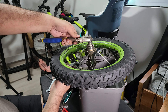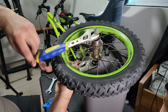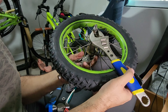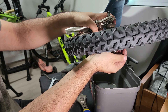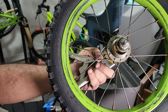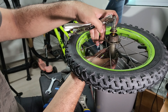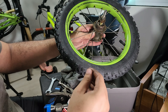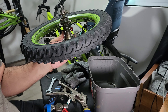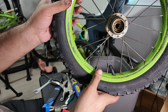Now I'll try to open the axle for the hub. For the center axle, you need to hold one end with a plier or wrench and rotate the other end to take it out. You need to be careful — the ball bearings are completely dried out, so have a tub underneath so you can collect them. Inside there's a lot of gunk, old rusted grease, and water ingress, so it needs a good service and clean up. Removing all the ball bearings — both sides had a lot of rust. Loosen the whole screw and the axle will come out, leaving you with the hub.